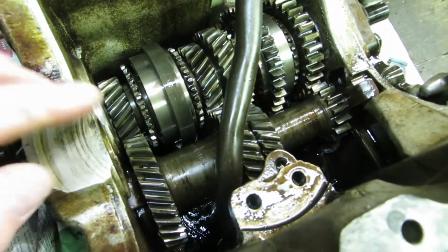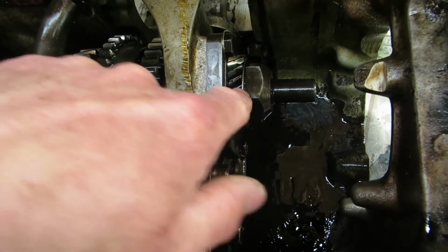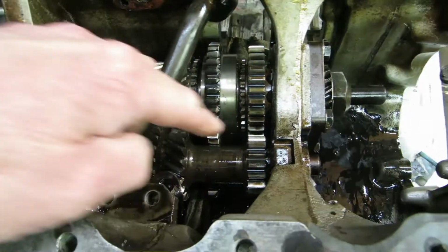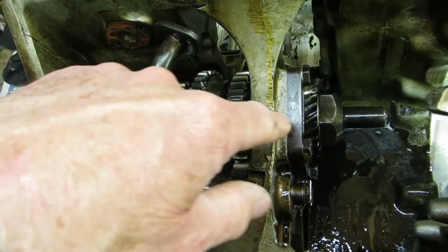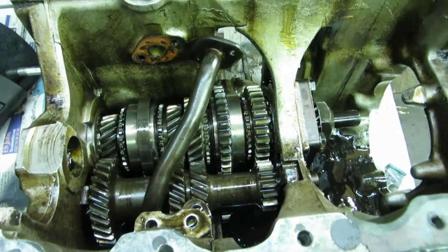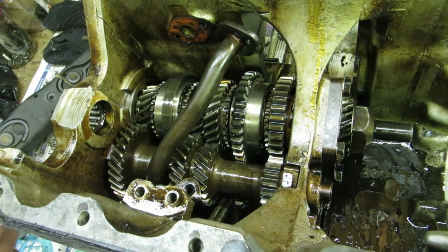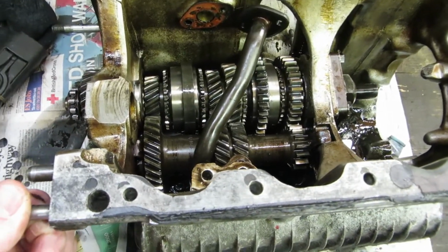I think that might be early A-plus, if it's A-plus at all. And the lay gear is a DAM 3168 lay gear, and it has an 18 tooth pinion here. Now, that means that this is essentially the close ratio lay gear. It's the same as the 1275 GT Cooper S kind of spec, and it's a 3.44 to 1 final drive. So it's the one to have. Cooper S is 3.65 to 1, 1275 GT is 3.44 to 1, and I think that this is a 1275 GT unit. Maybe a late one.